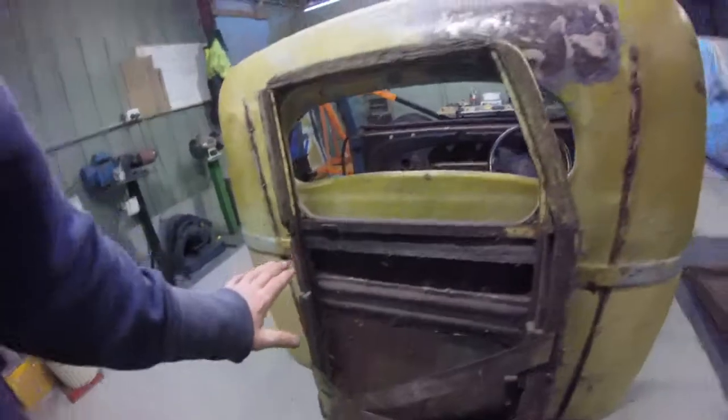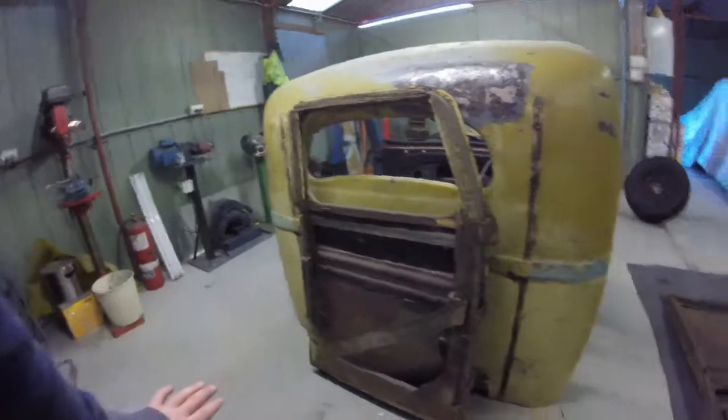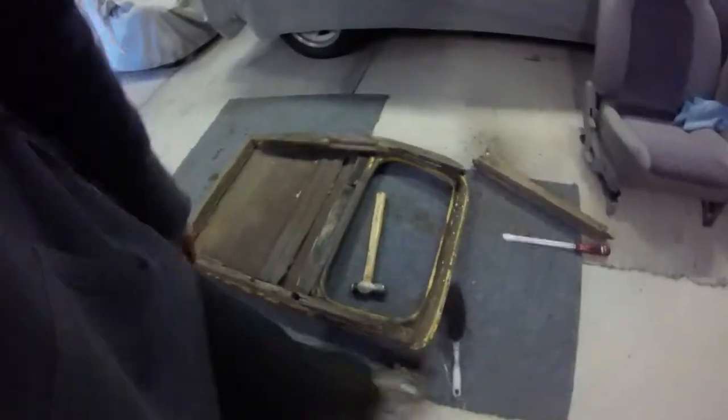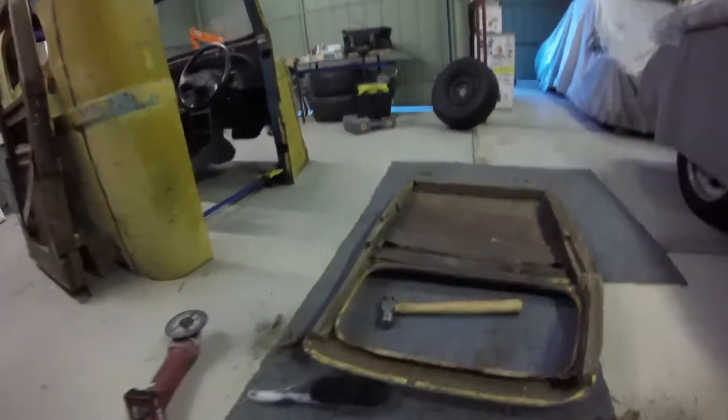So I'm going to leave this one because I haven't spoken to Mike in about a week and a half, maybe 2 weeks now. He's probably busy but still working on my windscreen opening. We briefly discussed what we might do with doors, whether we use tubing but sort of section it like a C-channel, or whether we make it out of sheet metal. We'll take these pieces out, trace them out on sheet metal, but make it one. My sheet metal's really long, so all we'll do is we'll lay all the pieces end to end, trace them all out, cut them out of that one piece of sheet metal, and then just basically wrap it around, bend it to the shape, and put one weld in it, one seam, and that will pretty much give us at least a shell.